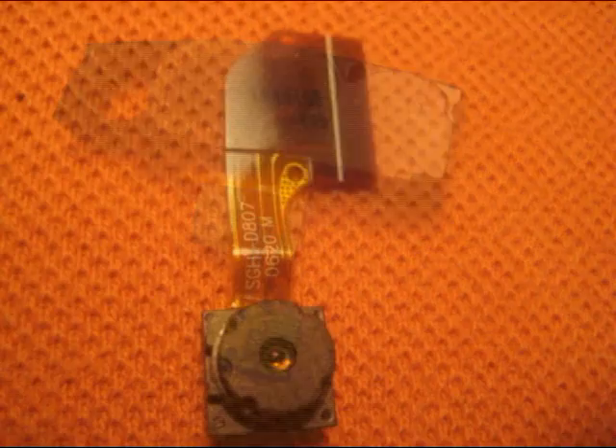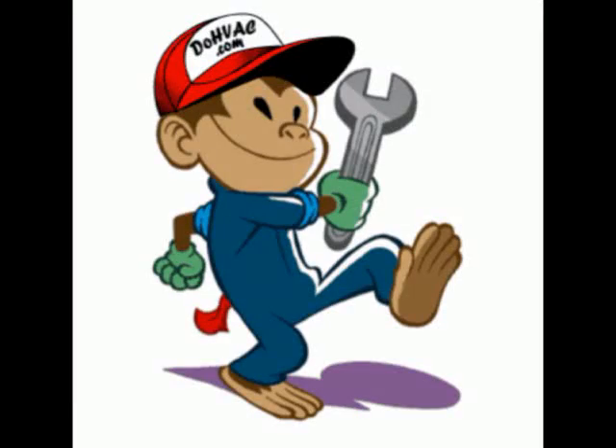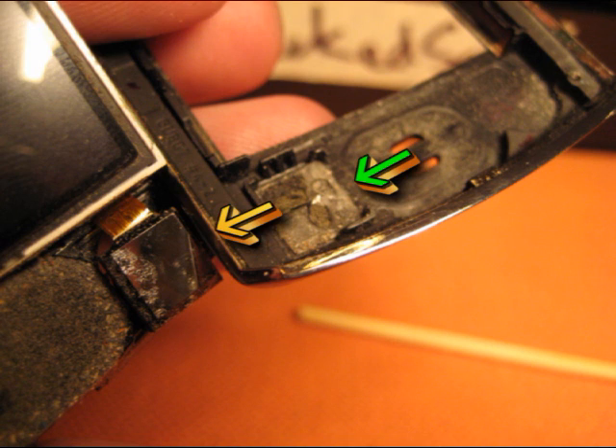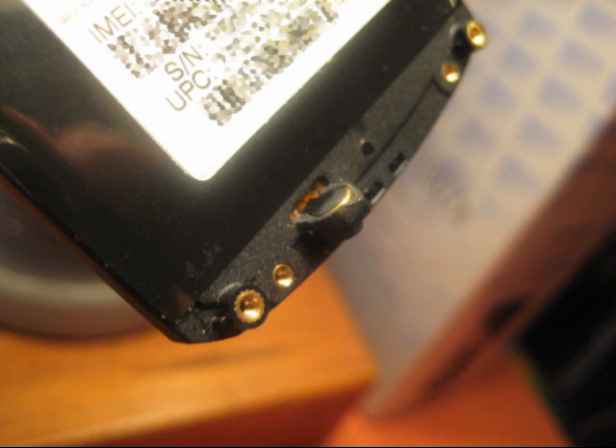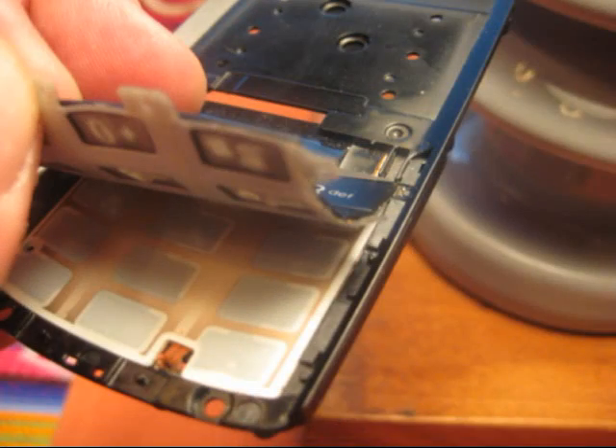The earpiece, camera, and keypad are also attached by clamping ribbon cables, so now you know how to swap those. The camera is glued in place to the plastic cover — pry it out gently with a screwdriver and hope it doesn't break; mine worked fine. The number pad has a separate screwed-on clamping frame and is then glued to the switch pad, so hopefully you don't have to mess with this or the microphone.